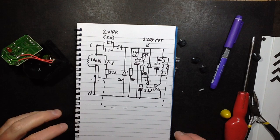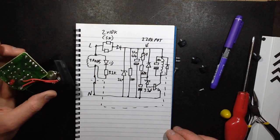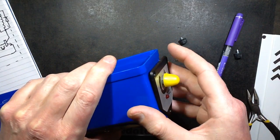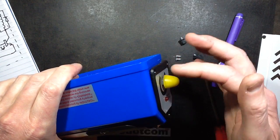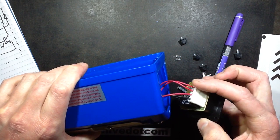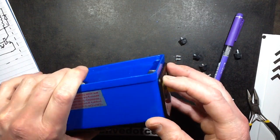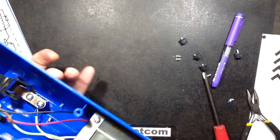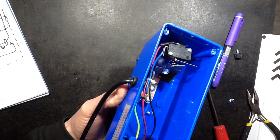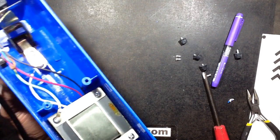When you let go of the handle it just powers down and resets — very simple. It's quite a neat device and it seems to work very well. Another nice feature: if you want to replace the electronic module, you just remove the front three screws, pull the module out, unplug the keyed connector, plug a new module in, and put the three screws back — you don't even need to open the case. The earth is actually bonded onto the transformer too. It's really quite nicely designed overall.